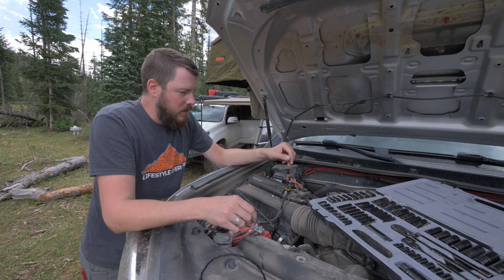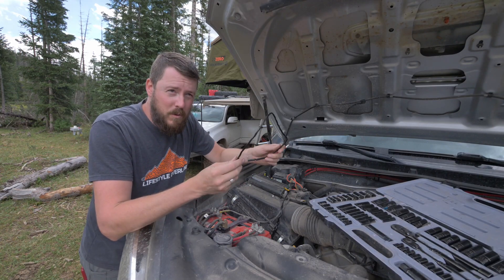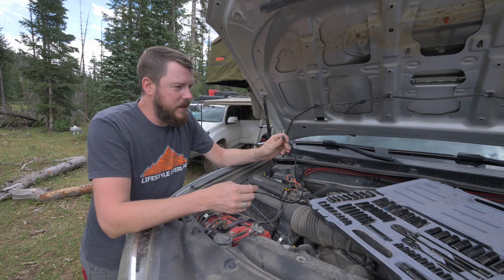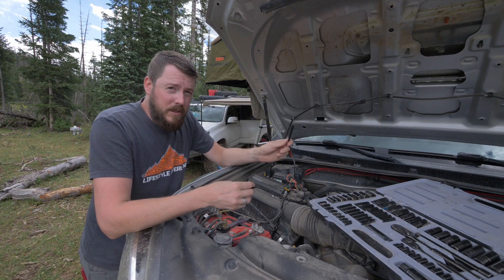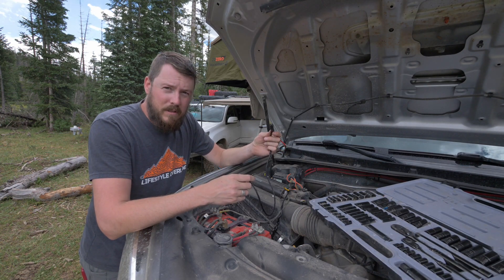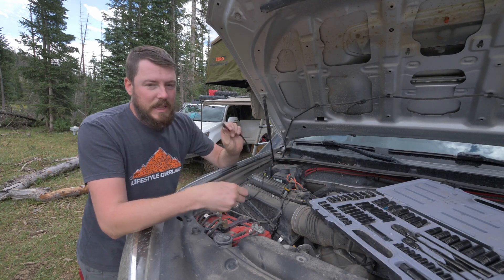I wasn't able to get the right gauge wire, so I've actually created a heavier gauge cable for the ground side of the solar itself using three number 16s. Not ideal, but we're out on the trail and it will carry the load we need. I'm just going to tap into this using the SAE connector — we prefer it because it protects the terminals a lot better. The panel came with an Anderson plug, but I prefer the small watertight seal of the SAE connector, so I've cut that off. Now I'm just going to tap into the DC to DC charger.